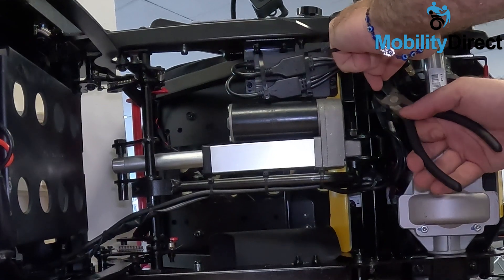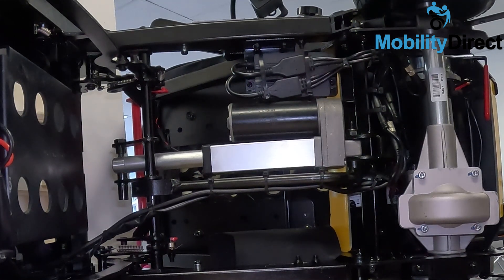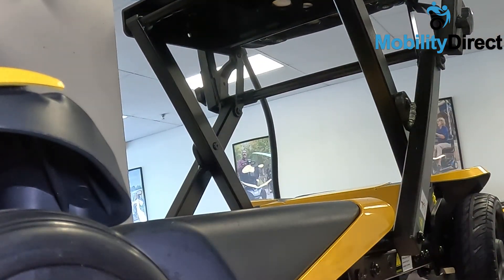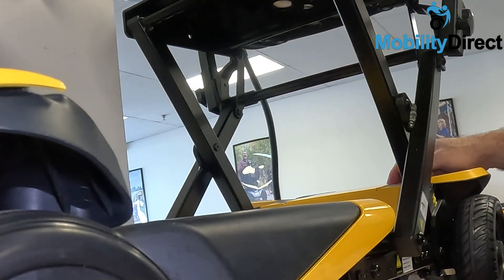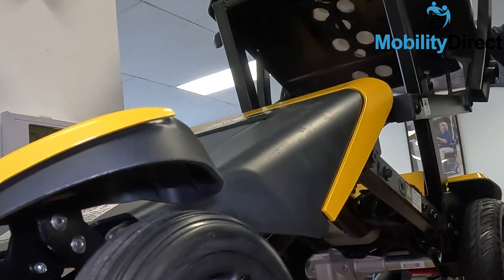Once you have all your zip ties in place, you can go back and cut off the tails of the zip ties so that everything looks clean, just as it was when you first started working on it. This is what it's going to look like when you have replaced your control module. For one last test, we're going to pop the battery in and give it a test on the back side to see if everything works using the manual button on the back of the scooter. The issue we had with this scooter was that the switch would not operate and it would just beep — that's a sign of controller failure. We went ahead and replaced it, pressed the button, and that ladies and gentlemen is how you install the control module on a Solax Transformer successfully. I really hope you enjoyed watching this video and that it was useful.